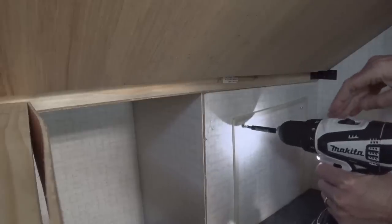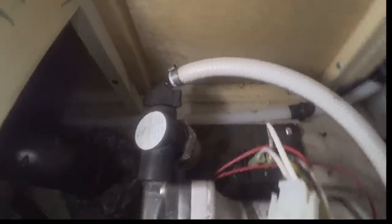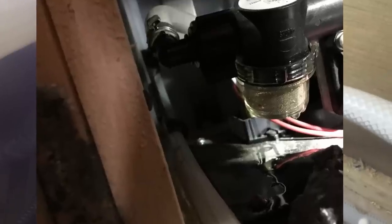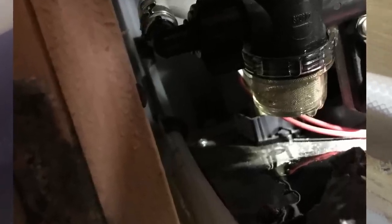The water pump on this J model is behind this door. Attached to the water pump is a little water strainer. It just screws on by hand, and if it gets loose it drips. We had that problem in Denali — after we were gone all day we came back and found a couple of quarts of water all over the floor and running into the systems.